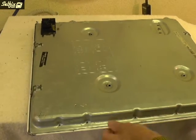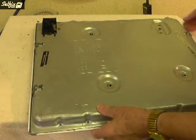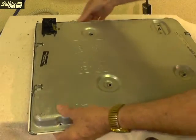There are two lugs on the inside edge of the hob that hold the cover down, and it must be slotted under these lugs for it to fit properly. The edges of the cover may need to be pressed together with those of the hob before the four nuts are fitted.